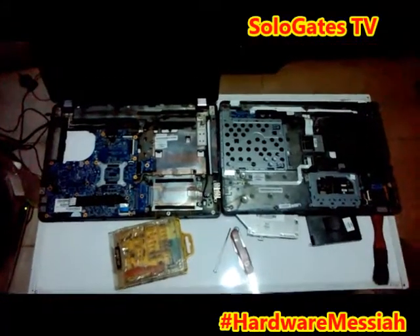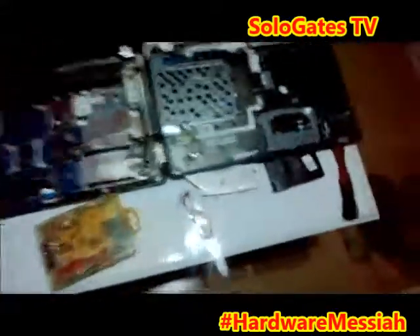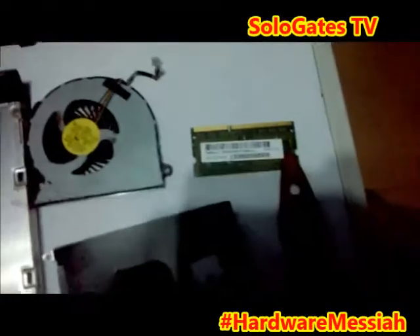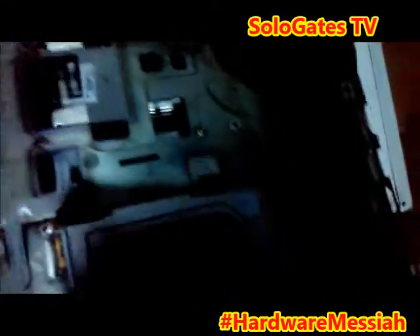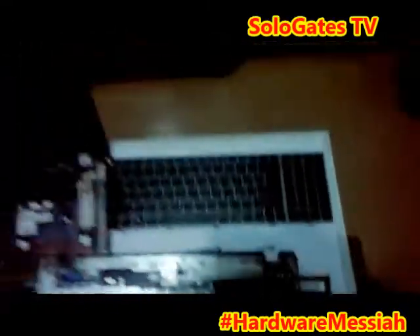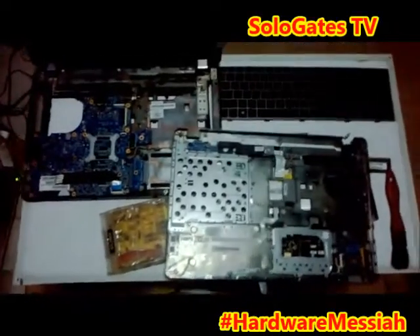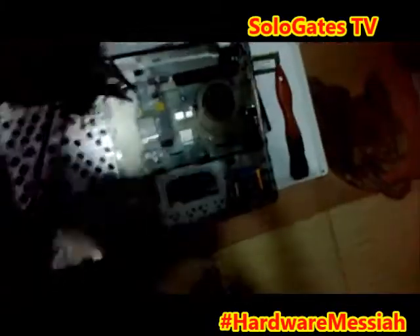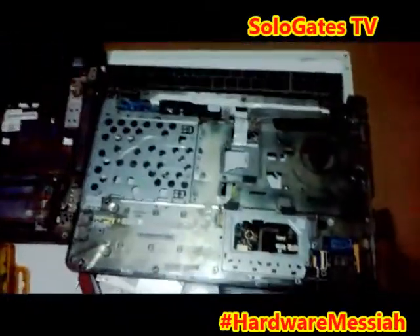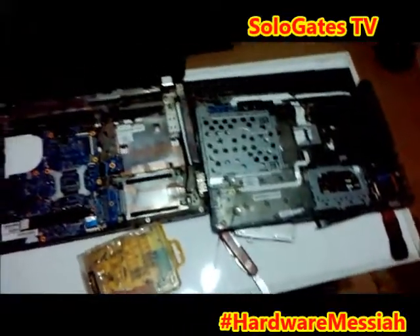To learn how to dismantle the HP, you have to unscrew everything and take out every device: the hard drive must be out, the fan must be out, the CD-ROM must be out, the RAM must be out, and the keyboard must be out. On the chassis there's a path that indicates keyboard — just press there, push things down and get the keyboard out, then unscrew what covers it. You can find a dismantling tutorial for that, but just unscrew everything, take the keyboard out, and you can separate the two compartments — the top and the bottom case.